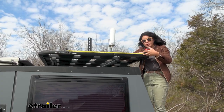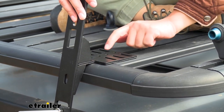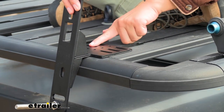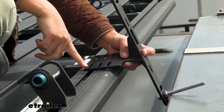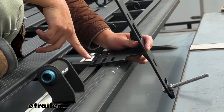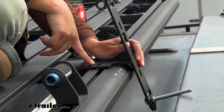If your bracket was off the side or on crossbars, you can put your bolts vertically. If it's on crossbars, you can utilize the tracks within the bracket to get as close to that 35-inch range as you want. If it's off the back or the front, you will be mounting your bolts horizontally. You also have different levels to pick and choose from — that way if you need your bracket to be further away from or closer to your platform rack, you can adjust accordingly.